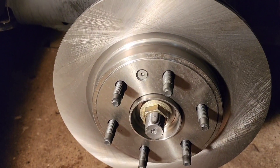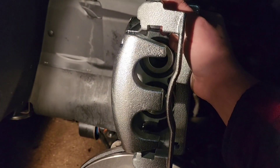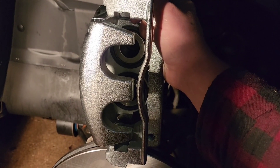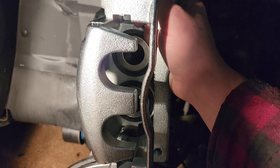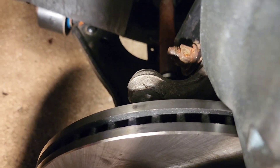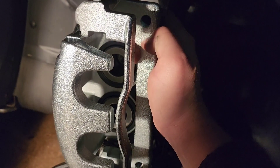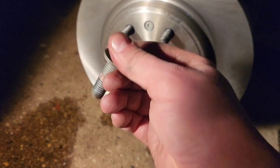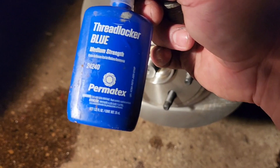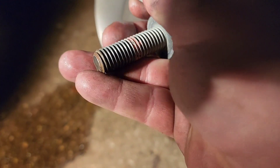Let's move on to installing the caliper. One thing you're going to notice with your new calipers is that the weight is a little surprising. When you start trying to install this thing, you'll notice that you don't have a whole lot of leverage. What I'm going to do is start with the top bolt into the bracket, and then once that's done, wiggle this around to get the bottom bolt on as well. What I like to do before putting bolts in — they have a lot of vibration — I'm going to take the original bolts and use some blue thread locker, just about a dime size.